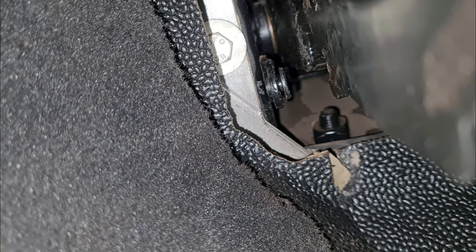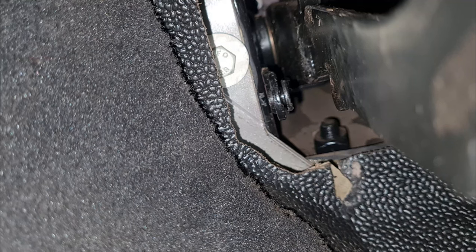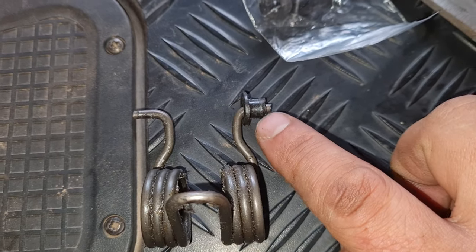And okay guys, just a tip to remove these plastic bushes that the spring pushes in. You need to wedge it on the outsides against the bodywork and then push it with something just to pop out. So then you grab it on the inside and pull it out. Basically, it's a bit difficult to record down here, but I'll continue with that. Just a tip. This is pushed in the side, this rubber, and it's not easy to push out.